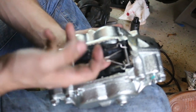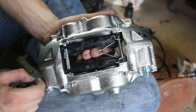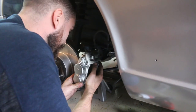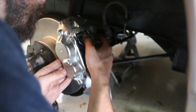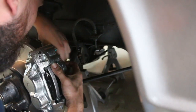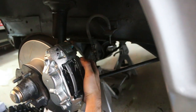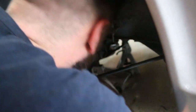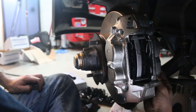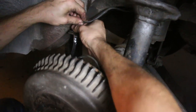We finally got the brake pads in there with these absolutely absurd clips that they provide you - it just holds the brake pads apart so they don't rub on the caliper or the rotor when you're not using them. Now all we have to do is bolt this up to the stock location, and we have to make that little brake line. Last thing to do is to fix the original problem which was this rubber line that we got in this morning. Bleed the brakes and the upgrade is complete.